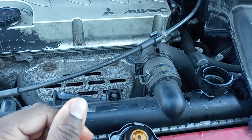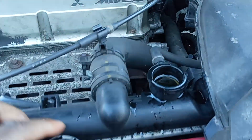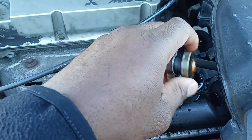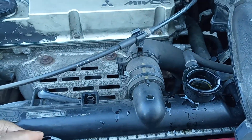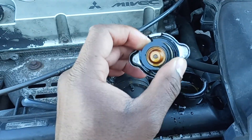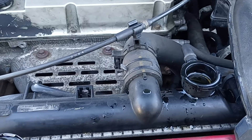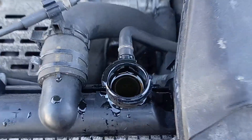You don't have to be a mechanic to drain your antifreeze. It's pretty easy. Just make sure you open this up first — open the cover first and take it off. Make sure the car is not hot, because if it's hot it's going to pressurize and can burn you. Make sure it's off and cold, everything not running.